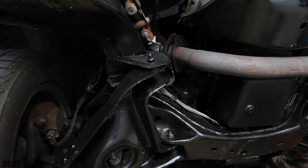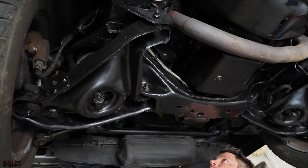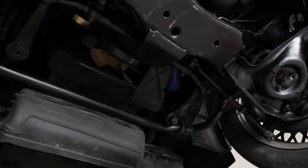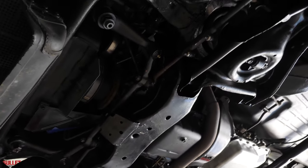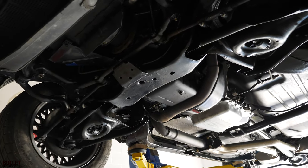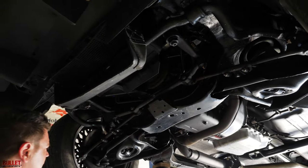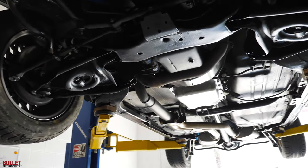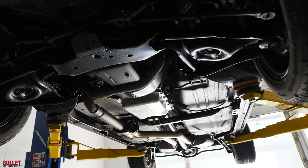Proportioning valve is in really good shape. Steering arm is in really good shape. Filter's fine. I don't smell any coolant — we were running it pretty hard, the temperature went to about 210, so not too bad. Tires, as I said, have 95% tread. It's a beautiful car, so whoever gets this one will be very happy.